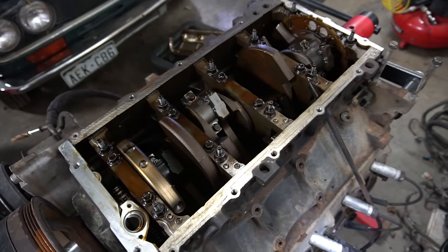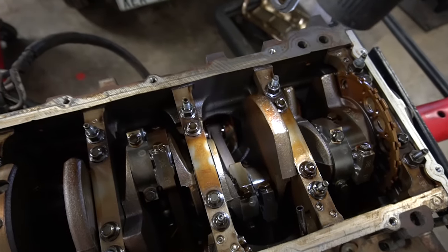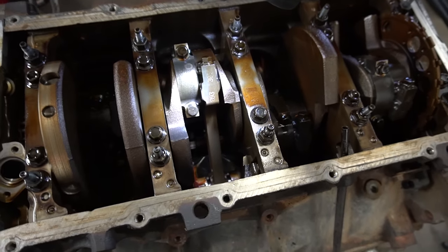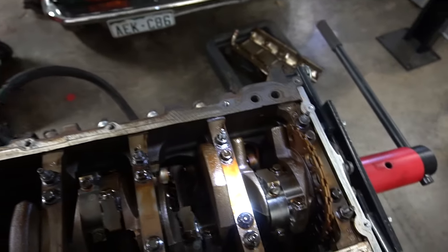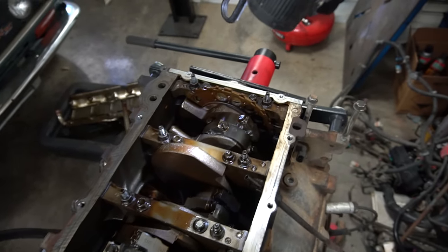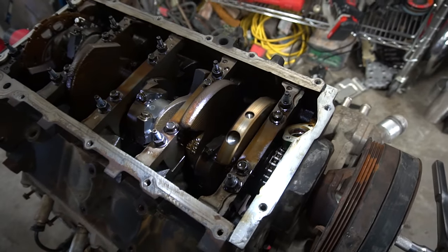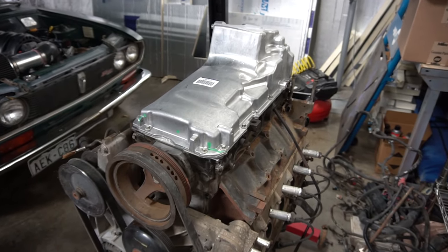This being an '06, I figured it should have Gen 4 rods, and from what I can tell using Google these are Gen 4 rods - they have a slightly different style I-beam and a little thicker on the bottom. Otherwise everything seems okay. Compression seems not the greatest but I think my 5.3 I ran before wasn't crazy either. Going to get the new pan slid on and try to drop it in.